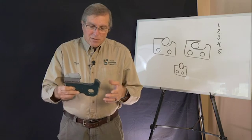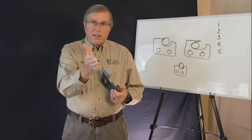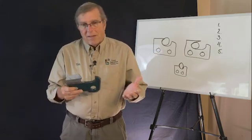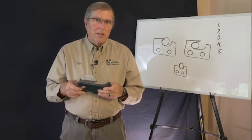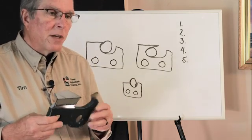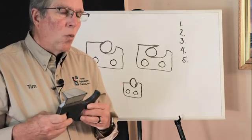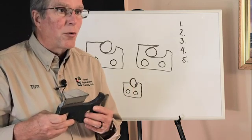So, what happens though when something is damaged? We have to repair it. If you've ever had a chainsaw start to cut sideways, left or right, what do you think causes that? In reality, it's usually one of two things. You can have a worn bar, and a lot of people talk about that, but most of the time, the two parts that really make a difference are the depth gauge and the point. So as we start to look at the parts of the tooth, there are 5 parts in the design that we need to be aware of to be able to either sharpen or pick another saw chain before we go to work with it.